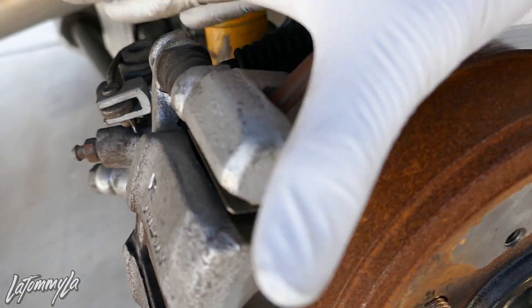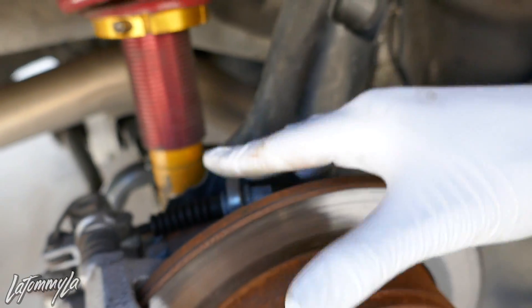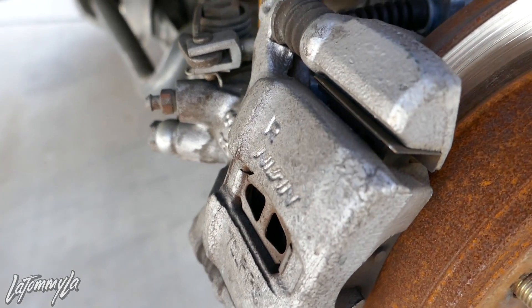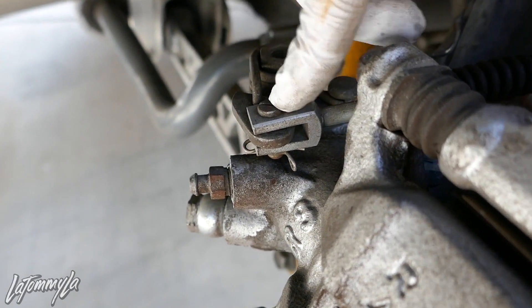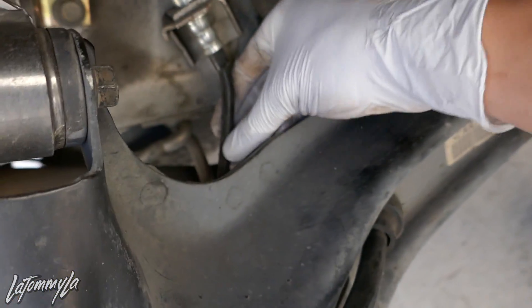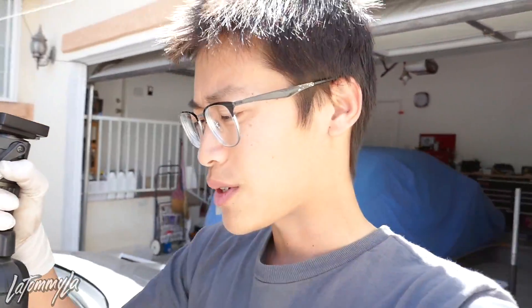There are about five bolts total. Since I have a rear disc conversion, if you have drums you'll need to take off the brake line at the rear brake cylinder. Luckily I just have to take off the e-brake cable and zip tie the caliper over. I do have stainless steel brake lines. Oh yeah — good news, I finally have a tripod. My other cameras were too heavy for it but this one works.